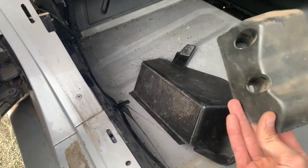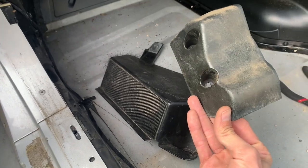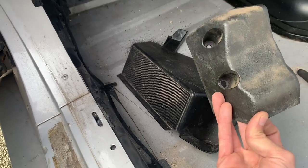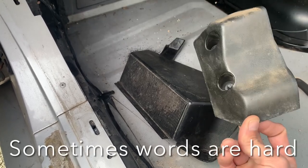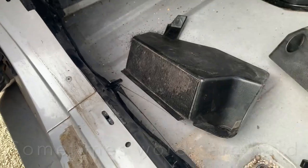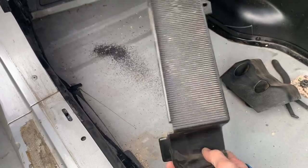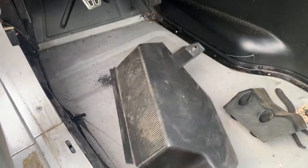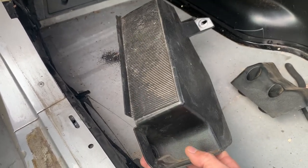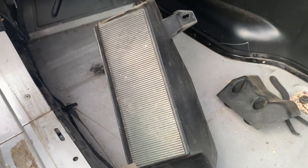You're probably going to want to go ahead and put these back in, because you really don't want to be flexing on that pedal in a race. You'll find that you put an awful lot of force on it and you could cause a problem if you don't have this backer in there - or this dead stop. So I recommend that you put this back in. In my other car, same thing with the dead pedal - I didn't find a reason to do anything other than run the stock version. One note on the dead pedal: I did not realize when I did my first car that there were actually two nuts holding it down.